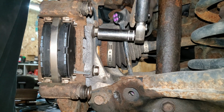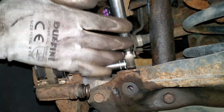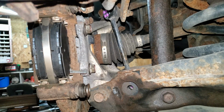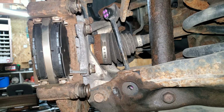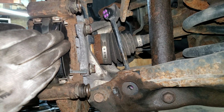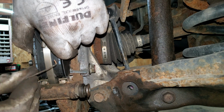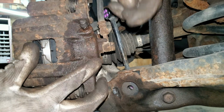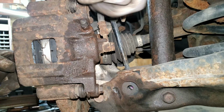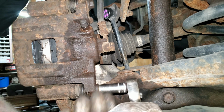These bolts get torqued to 65 foot-pounds. I cleaned up and lubed this caliper the best I could. Looked pretty good. I couldn't find any new springs for this, and they didn't have any in the hardware kit for the pads, so I got to use the old ones. Turn these pins to get them to slide in the grooves. These bolts get tightened to 27 foot-pounds.